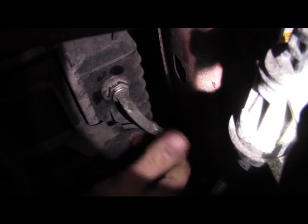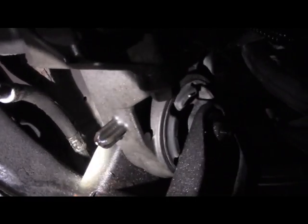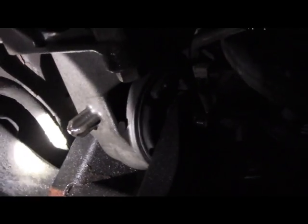It doesn't look good — I'm going to have to twist it. I may have to just leave it in there and cut it back with the pipe cutter, because it'll go in between. First I'm going down below to cut those rubber hoses off. As you can see we're on the front of the car — it's not an easy spot to get at. You can use a knife or side cutters to cut that rubber hose off right there. If you buy new lines, they're one piece and you don't have to fool around with hose clamps, but it's expensive. So I'm going to cut those off, pull the line out and wiggle it. If it doesn't come out, we'll cut it with a pipe cutter and put our union in there and make a new line.